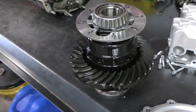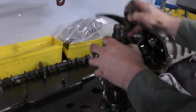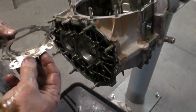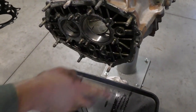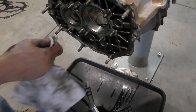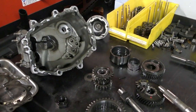Fancy limited slip differential. I just pulled the pinion shims off — I got two shims there, I'll clean them up and measure them. Nothing else stuck. The pinion shaft bearing doesn't look horrible, definitely seen some miles. Same for the input shaft bearing race — no obvious damage but definitely showing signs of wear.